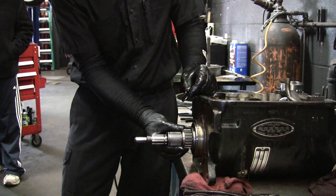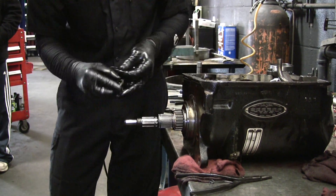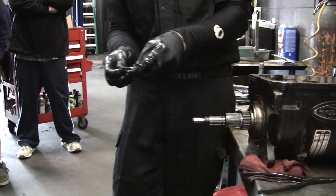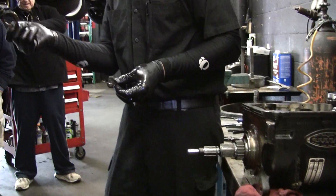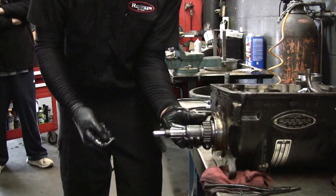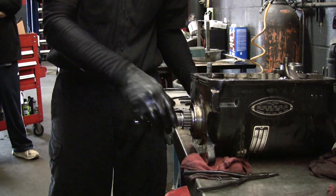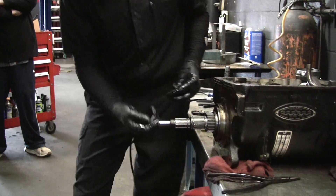Before this pump will come out it's held on with another snap ring, a steel thrust washer which goes on the outside, and a composite brass thrust washer — and that's to keep everything in the right place. See how that floats? That's the drive for the pump. Now we've got the two bolts that hold the pump on in the front.